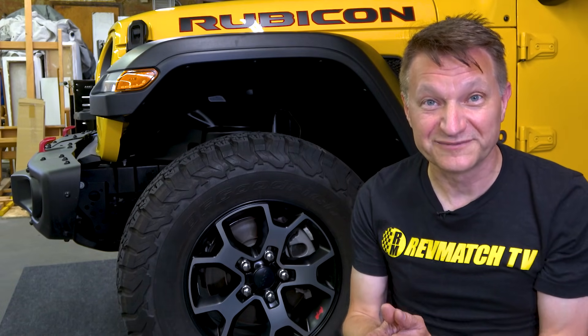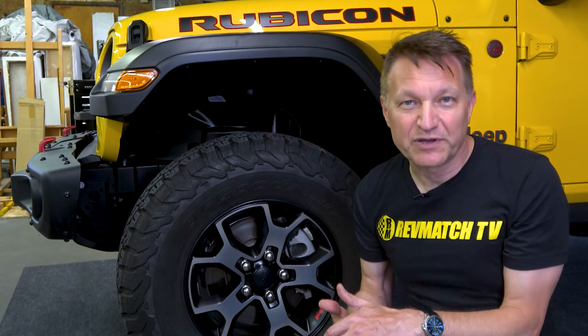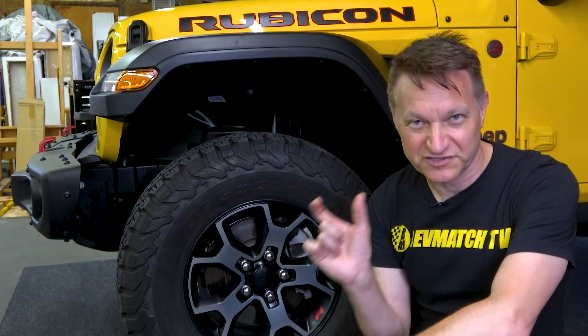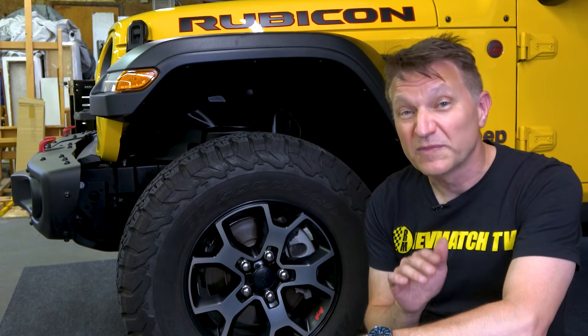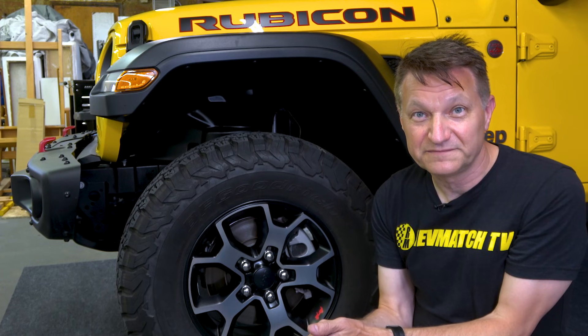There are two places you can get the correct torque values. One: buy a manual — you can find these at O'Reilly, NAPA, Pep Boys, or places like that. Chilton's is a pretty common brand and you can also find them on Amazon. Two: Google it — just type in 'wheel torque specs' and your car. Look at a few values, figure out which is the official one, and set it there. Most cars are going to be in the mid-80s to low 90s in pound-feet; my BMW is about 90 pound-feet.